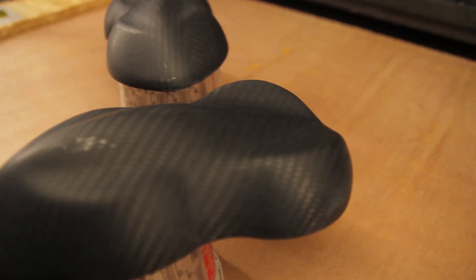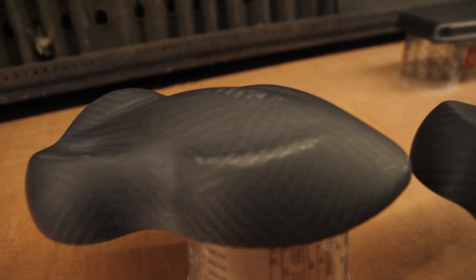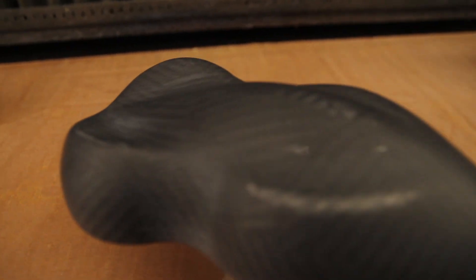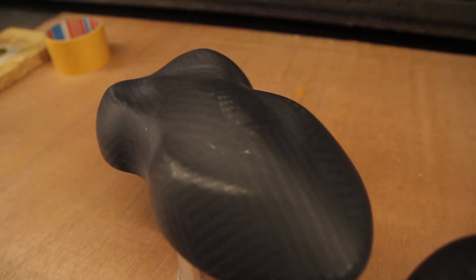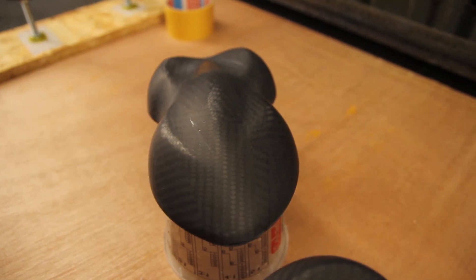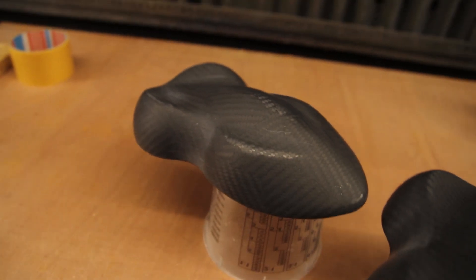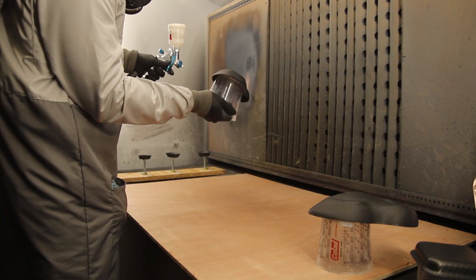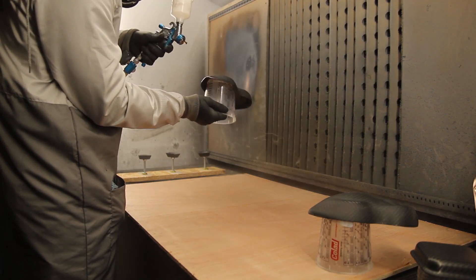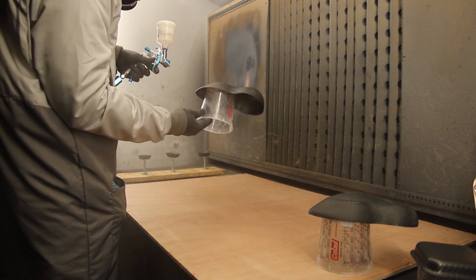After sanding again, you'll mostly see some glossy little pinholes — this is not a big problem. It's because these are still slight low spots that haven't been sanded all the way down, so you see little glossy points at the pinholes. Then with the third coat you can go quite light, just to create a nice and even finish, and then the parts will be ready.